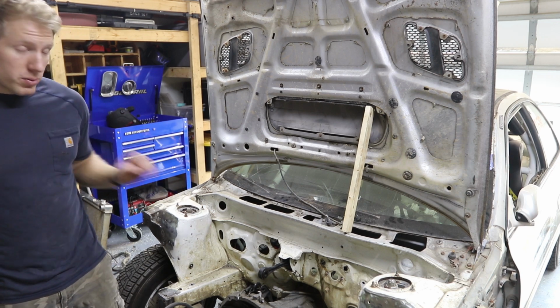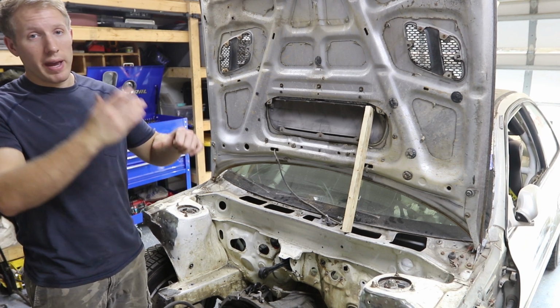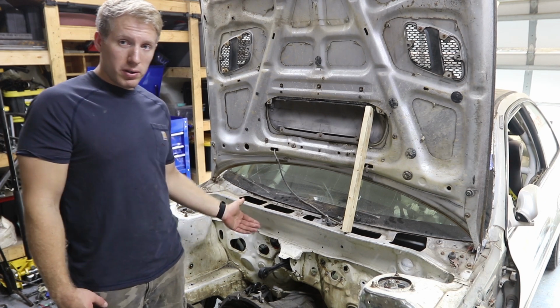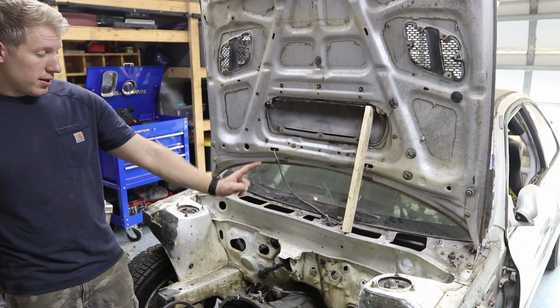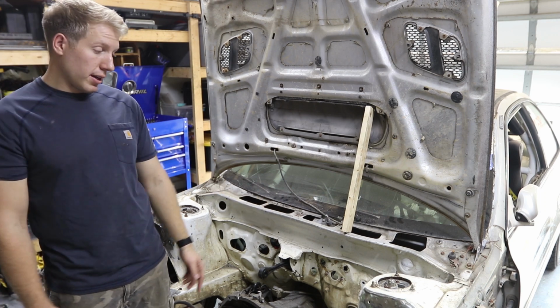We need those two. Those are going to be the big, massive wiring harness things that are passing through the bulkhead. Those are going to the engine and the transmission, everything like that. So we got to leave those open. And then we have the heater core lines. Those are going to pass through. We can patch one of those little holes up there. Clutch master, we need to leave that. The throttle cable, got to leave that.